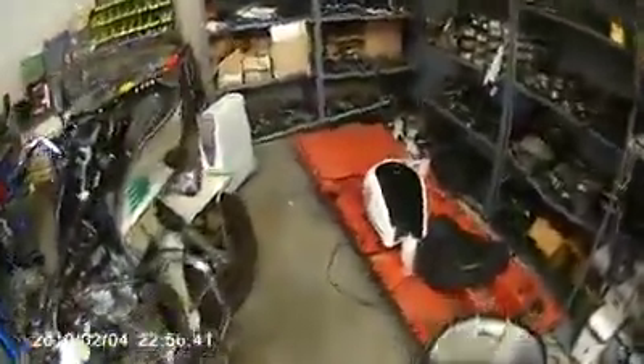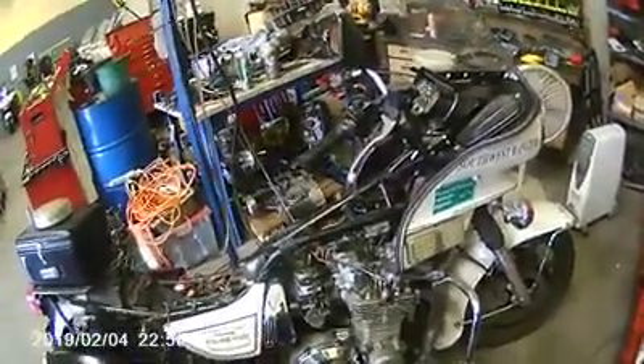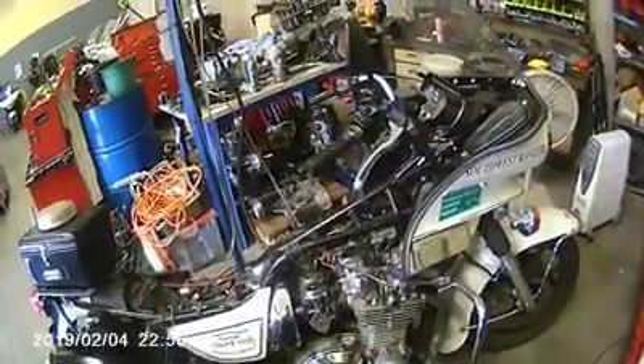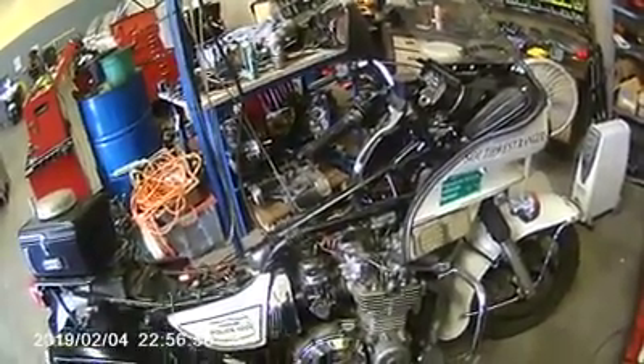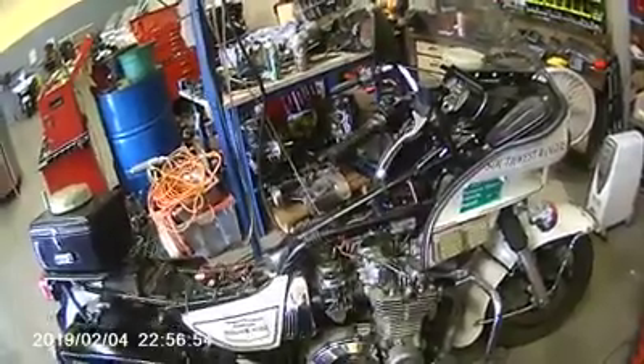As you can see, it's hooked up to a remote fuel supply so we can get it started. Haven't run this bike in probably at least six months. It's a bike we haven't used much in the last year or two because it needs a valve job — when you start it up and it runs, it smokes a bit.